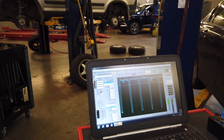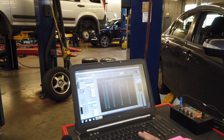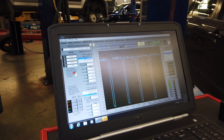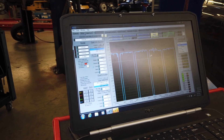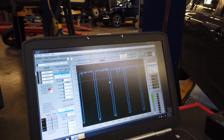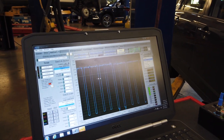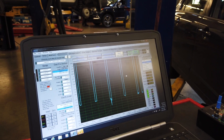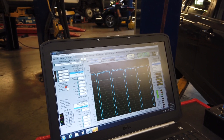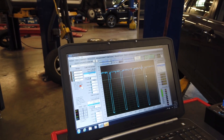We believe that this car has a bad crankshaft sensor. What we've been able to do with the cursor is line it up on the lower ends of these dropouts so that each time it drops further we're moving the cursor to catch it. Here we're dropping near a volt, and we see several areas of this waveform where we're dropping that voltage pretty consistently. We've been monitoring this for about 45 minutes and the waveform keeps getting worse and worse.